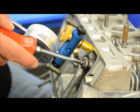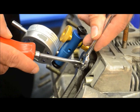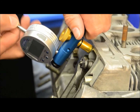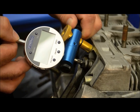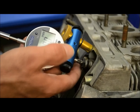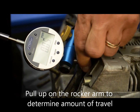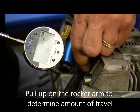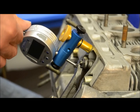Lock down your adjuster, then pivot the tool back into place over the adjuster screw. Lock everything down, turn on our gauge and zero it out, then check. And we're at six hundredths of a millimeter.